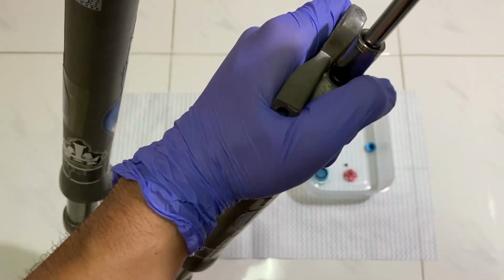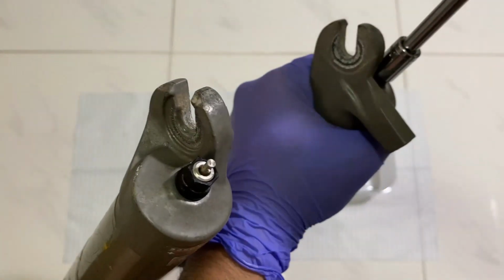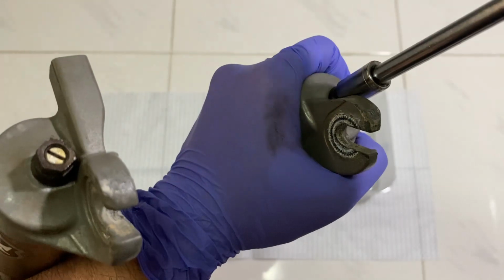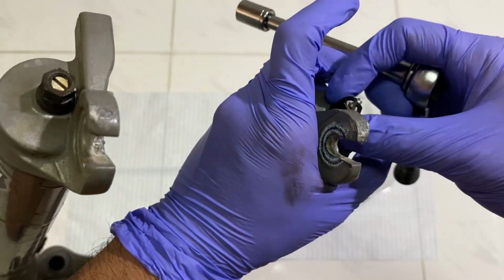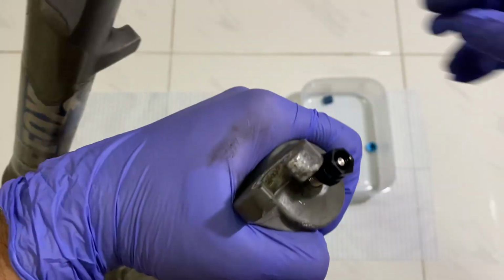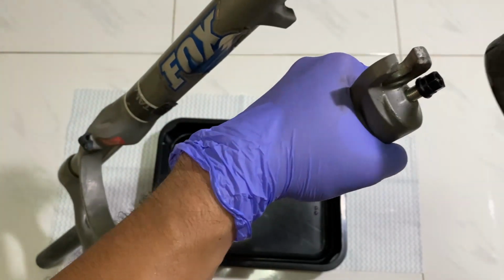Remove the foot nuts using a 10 mm socket wrench. Unthread a nut until it has enough gap, and to protect the adjuster. Use a rubber mallet to knock the damper leg and air spring leg free.